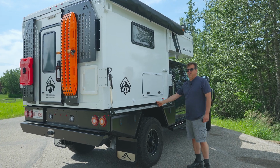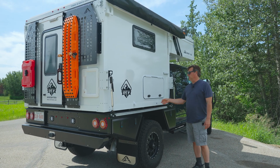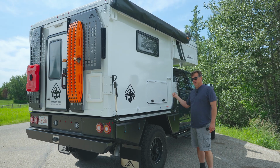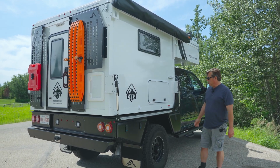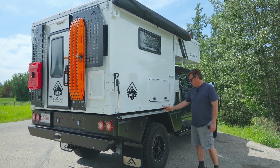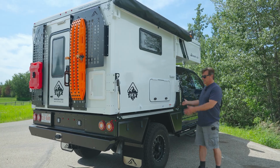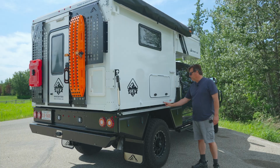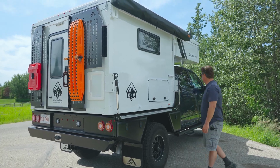Now, the center of gravity on our campers is always taken dry weight. The water tank in a CAMPX or a CAMPFX is 20 gallon, which is about 200 pounds-ish. So dry, we are forward of center of axle with this orientation that we've got. If we were wet, you're probably going to move that about 1 inch to 2 inches forward.